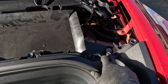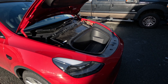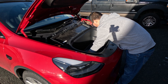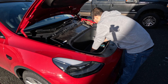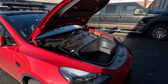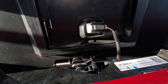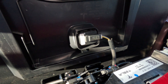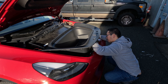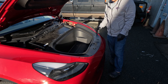Two more 10 millimeter bolts hold the HEPA filter in place. Now that you know where all of the hardware is, let's go ahead and remove everything. None of the hardware in the frunk should be high torque — you should be able to break them free; I was even able to use a little Makita ratchet. Before you remove the frunk, be careful: there is a connector that you will need to disconnect. This is a simple electrical connector, but you will want to depress the little tab in order to disconnect it. Once you've disconnected the connector, simply lift up on the frunk liner and it's out.